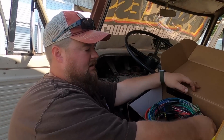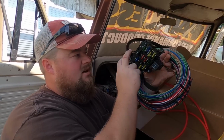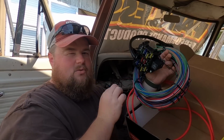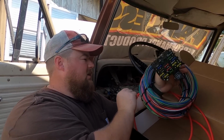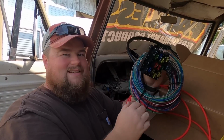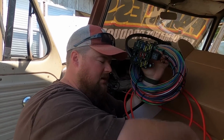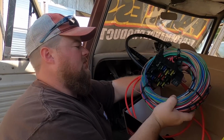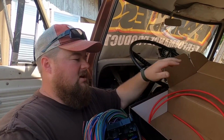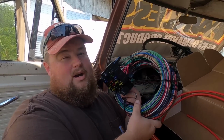And sort of last but not least is the actual wire bundle itself. You've got the fuse block, you've got some relays here, places for your flashers, and then all of the wire here. The really cool thing about this wire is each individual one is labeled for what it is. If I just pick one out, let's say this little brown one, it says it's headlight section A, two headlights, low beam. Tells you exactly what it is, and that is stamped the whole length of the wire. After that, there's a mounting bracket for the fuse block and then some dielectric grease, which is the stuff you use to keep your electrical terminals from corroding in the weather. And then some really thick gauge wire, probably for the alternator. So this is the heart of the bundle. This is the wire kit itself. We're going to start by mounting the fuse block in a good location, and then we'll start wiring this thing up.